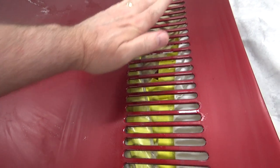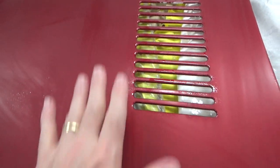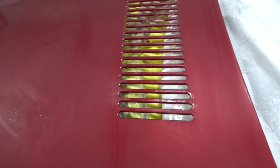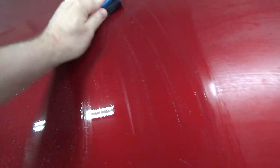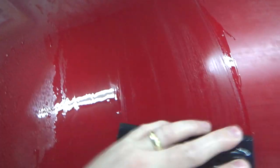I am going over this gently with the 600 wet as well, but that's mostly going to be gray scotch brited. You can see this area is all beautiful right here. I'm also trying to work on small areas at a time and not to go too far — stay in one little area.